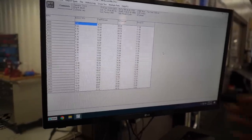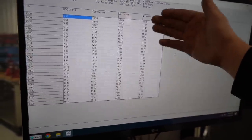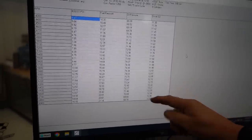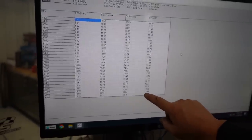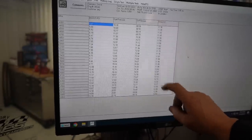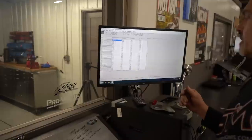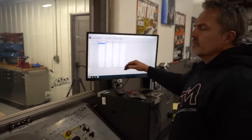And so now we've got it. So it's at 1130, you know, 1140s right there, and then 12 finishes off at 1262 right there at the very end. Probably discount that very last number. That's why we're gonna rev this up just a little bit more. Rev it up to 7500, make sure we're not gonna end up in any issues or any problems right there, like it to flatten out.